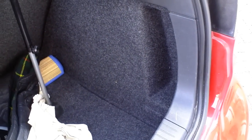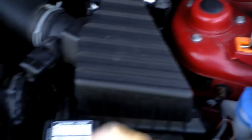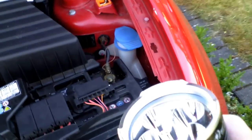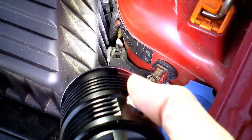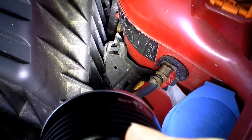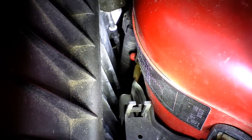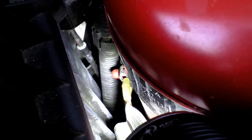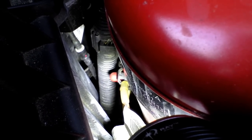Moving back to the front of the car, we'll look at the most likely causes. If you have water round by the front wheel then it's most likely that the actual pipe has popped off underneath the air box where your air filter goes — just this area of the car. This area is very tight, especially if you have the 1.9 diesel unit like my car. If we carefully look down the side here, what you're looking for is the black pipe with the little white collar. That's the actual root of the pipe and that's where it's most likely to have popped off. I'll get my laser in here just to show you — you're looking for any break in this connection and any water that may be around here.